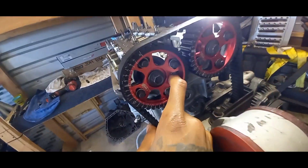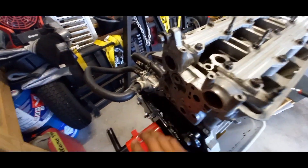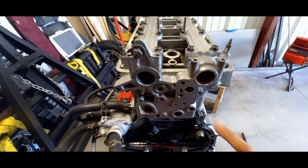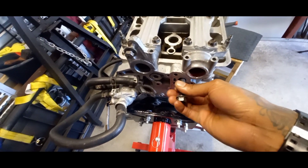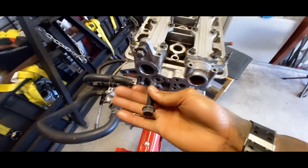I did have to take that out — there's a big nut back there, it's like a female fitting. I had to unscrew both sides, and then there's one right here, but not one up in here. You use a 14mm bolt that you can just put in there, thread it in, and pull the entire shaft out either way. But these end caps have to come off before you can do that.